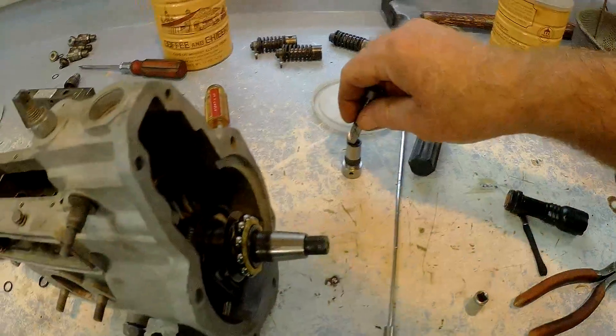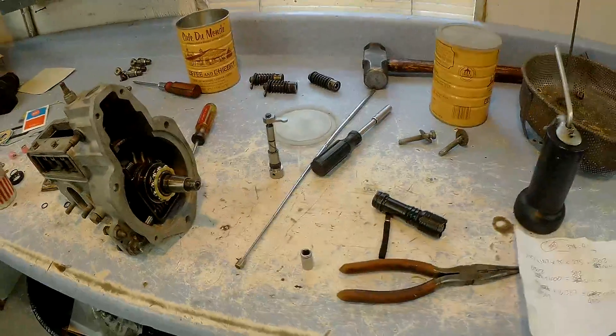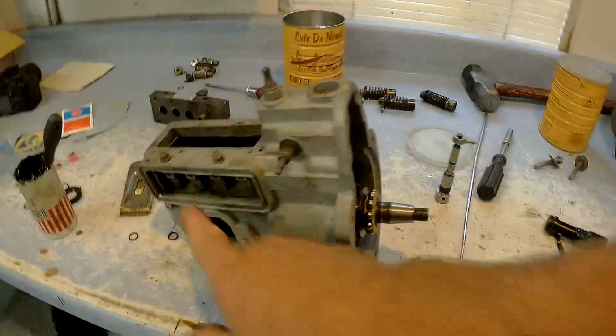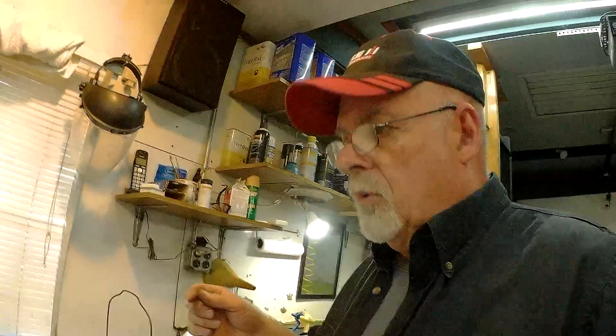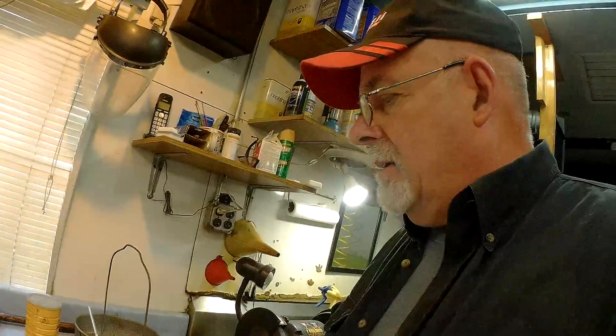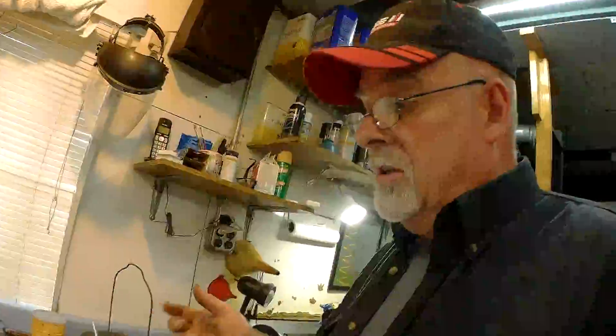So that's what we're doing here. You pay a lot of money to a pump shop for this work, so I'm just going to do it myself and then take it over to have it put on a flow bench where they'll make the final adjustments and print out a readout telling me the actual fuel delivery. They'll get each plunger putting out the same fuel, because you don't want one putting out more than another — that cylinder will be working harder than the rest. In the diesel world, fuel is everything — give it more fuel, you get more power, to a point where you start running out of air. Going to try and have it together for our fair in a couple of weeks. If you have any questions about the SIMS pump, feel free — thanks for watching.